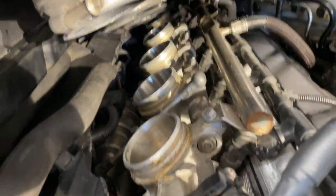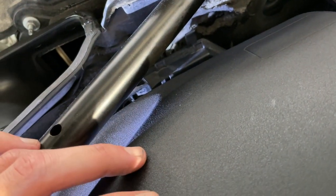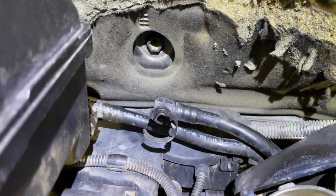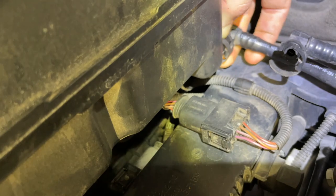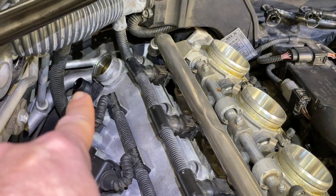With the plenum off, you can see the throttle bodies and all the hose clamps on the intake plenum. On the back of the passenger side, the wiring harness clips into the plenum via pegs into holes — lift that up and push it out of the way before removing bank one. At the very back there are two more small hose clamps. The most difficult hose is all the way in the back on cylinder bank one — that's the hardest one.